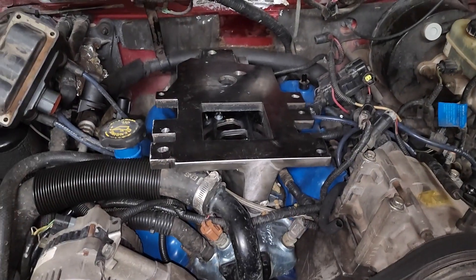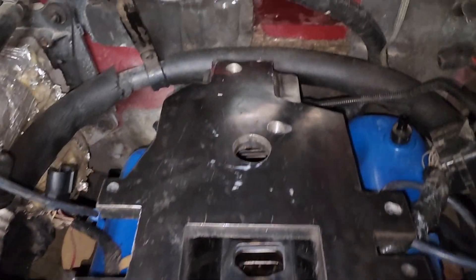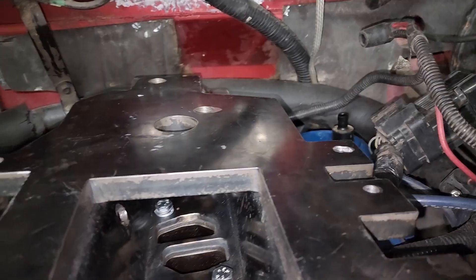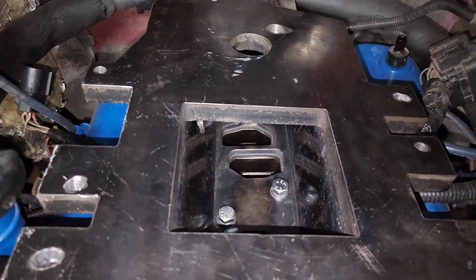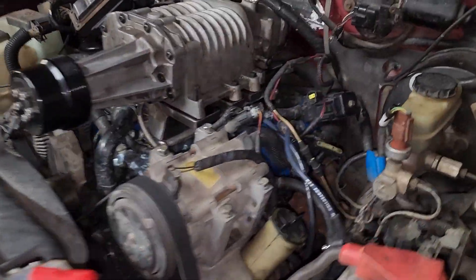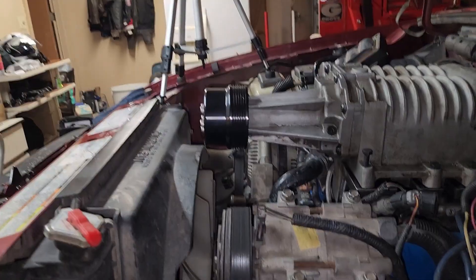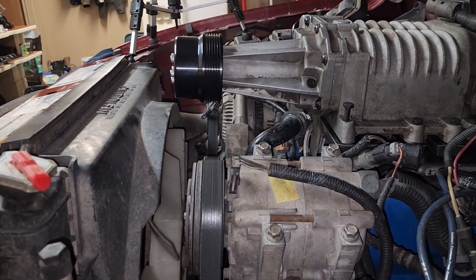Here it is — it's on. It definitely was a little bit trickier than expected. The holes I drilled allowed me to get the extension through but not the socket; I didn't drill it big enough. It was tricky and a little worrisome — if I dropped that socket I'd have to take the whole thing off and fish it out of the intake. But I got them on and tightened. Next up is the supercharger — there it is sitting on there. I want to check the belt, so I'll get the stock belt off and get a rope around it to measure the belt size I need.